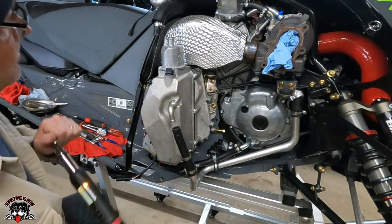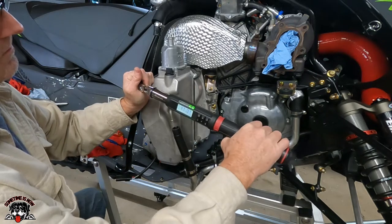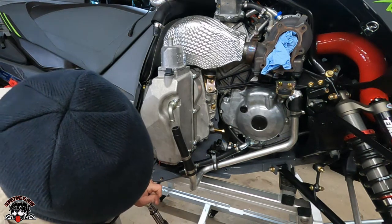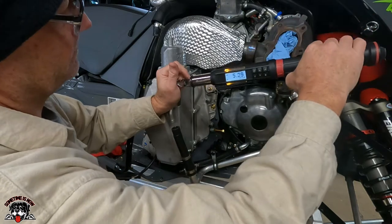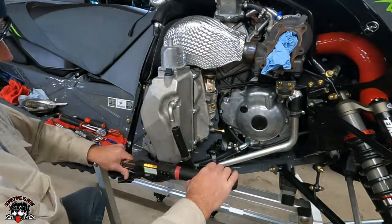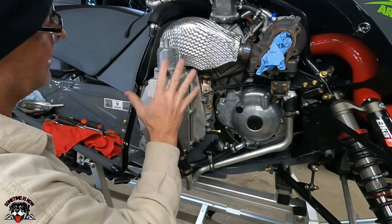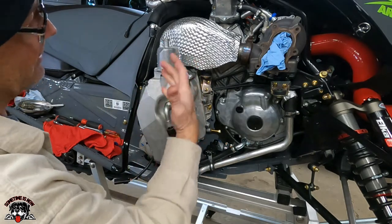Okay, well, let's start out. Let's go up. There's 12. I'll tell you one thing, I wouldn't want to go much farther than that. I think I'm going to stick with 12. Okay, so I torqued them all to 12. There's no way I'm going to 14 foot-pounds like the service manual says. 12 is good enough, because you feel it, the bolts don't feel right.